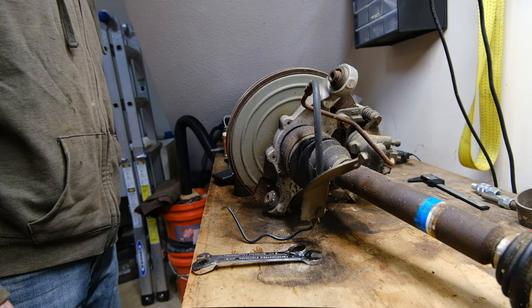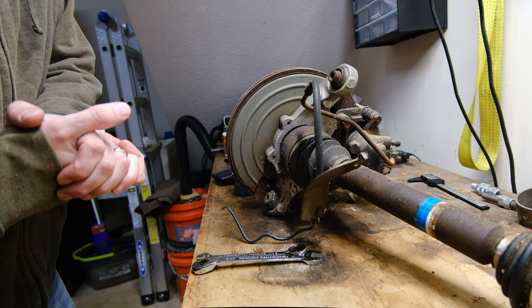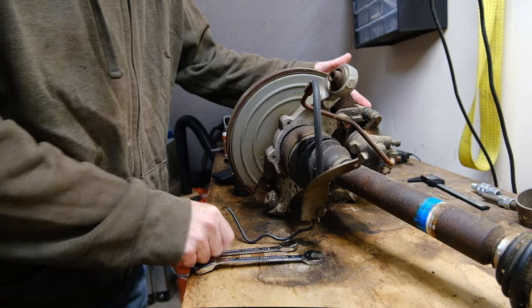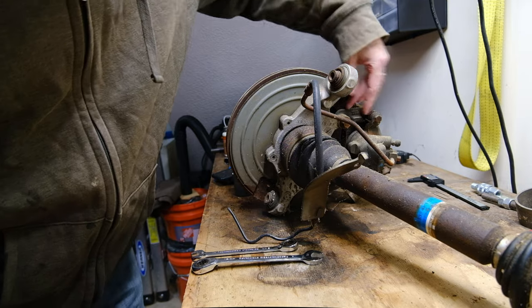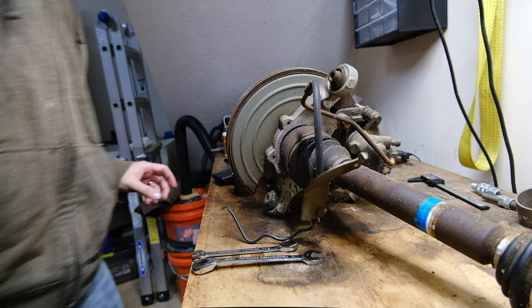Thanks for watching Skip Feed. The goal for this video is to disassemble the rear uprights and get them ready to be rebuilt. Disassembly of an IRS knuckle — I'm going to start with taking off the caliper, which is a 13 millimeter here and here on the bottom, and then taking off the caliper bracket, which is 15 millimeter — two bolts. That should free us up to move around to the other side.